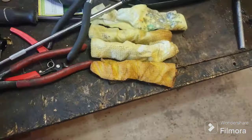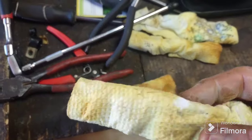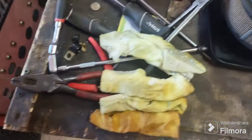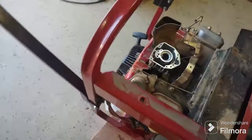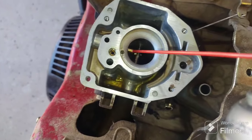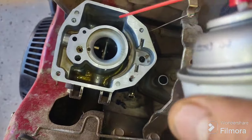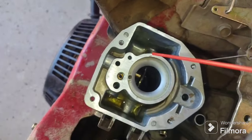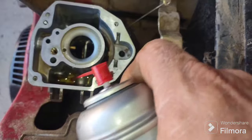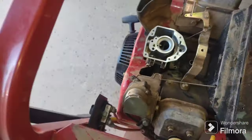I'm going to push some air through that and call it good, then reassemble the carb. Here's the progression of cleaning — first round of carb spray down inside the bowl was pretty nasty, getting better, getting better, getting better — not too bad on the last one. I can't quite get that one jet, so I'm going to put the bowl back together with about a quarter inch of carb spray sitting in the bottom, so that's the first stuff it picks up and it'll kind of clean itself. That plug in there doesn't come out, so we'll give it a shot.